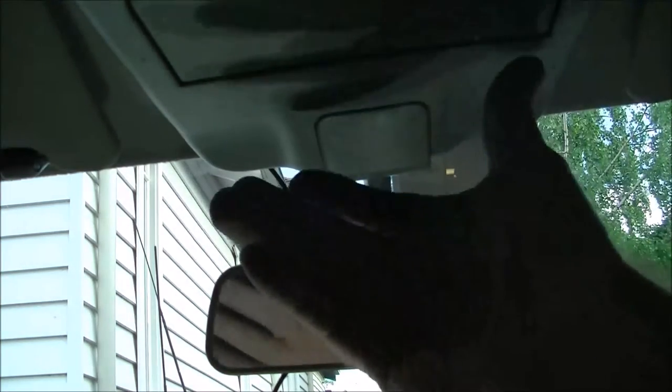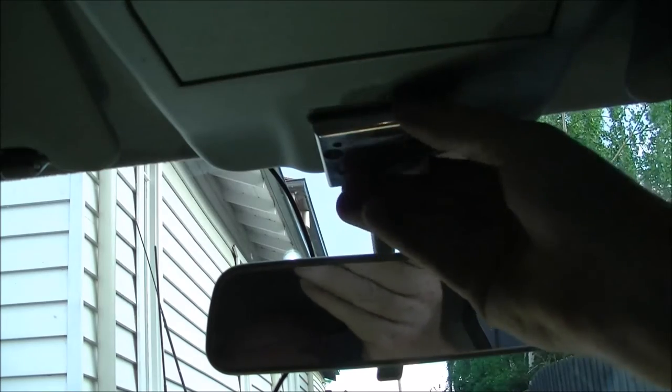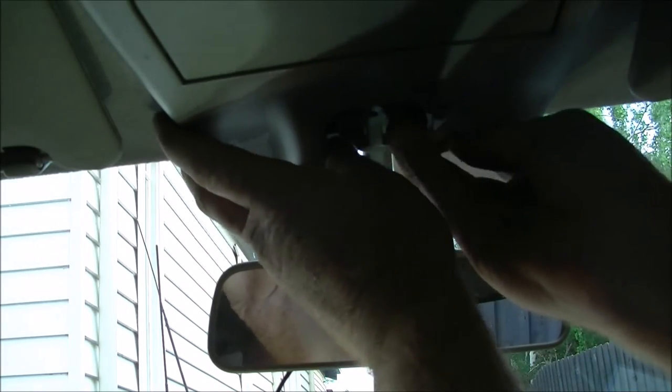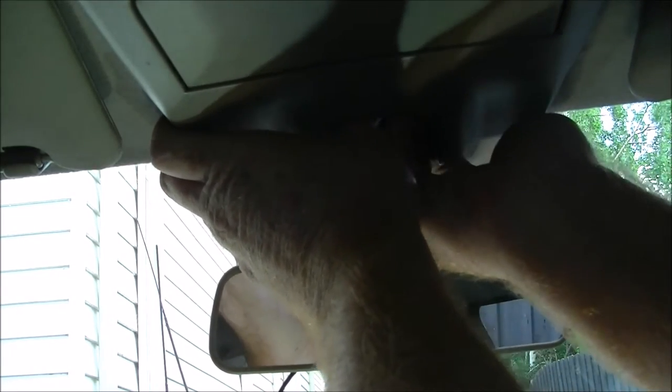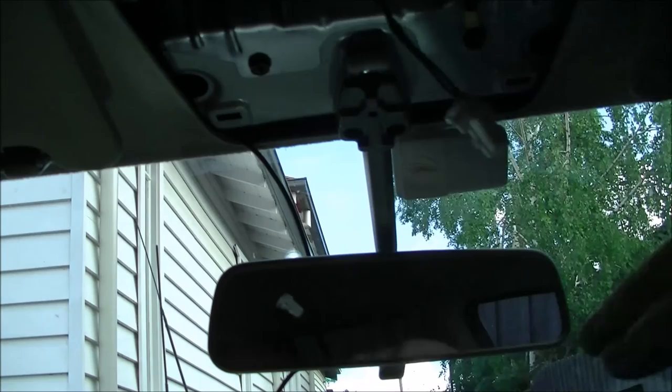To remove it, first you've got to remove the whole rooftop centre console. I've got it half undone already. It's fairly easy — you remove this first plastic clip which covers over the mirror, and this is the piece we're going to end up replacing with our custom piece. That'll slot into that position there, and if the ball's all removed it actually still looks okay because it's polished aluminium. To remove this, first there's a screw up inside your sunglass case — just undo that screw, I've already taken that out. Then get your fingers into the hole at the front and pull downwards — there are two clips there and two clips up the back, and there'll be a cable so don't pull too hard or you'll break the cable. Once you pull it, it'll loosen, then it's just a matter of pulling the second clip off. I've already disconnected the cable — there's just a power light — and that's taken out of the way.